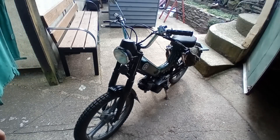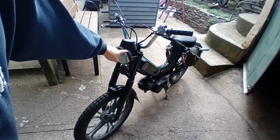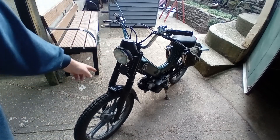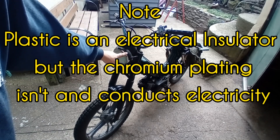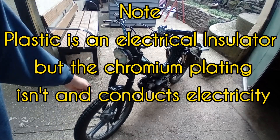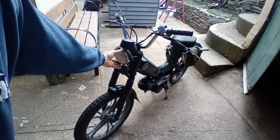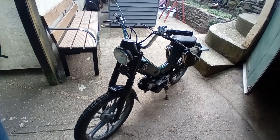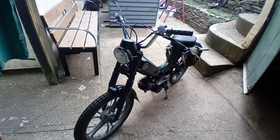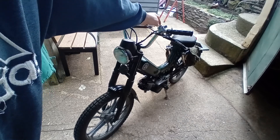That's all done now. Something to point out though: if you've got an early A3 with this type of headlight assembly — that's the single-filament bulb, not the twin filament like on the later A3s — this chrome-plated plastic also serves as the ground connection for the headlamp bulb. There's not a separate connection on the bulb holder itself; it's done through a contact inside the bowl. If you haven't got that screen on tight, it makes a very bad connection and the headlamp doesn't work, but the pilot bulb does.